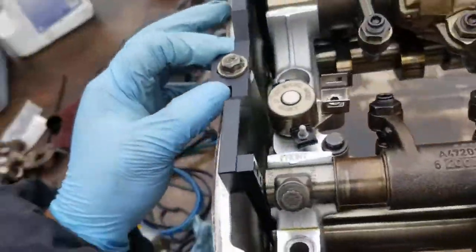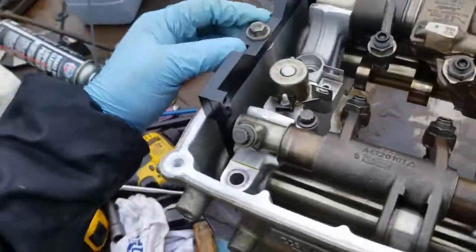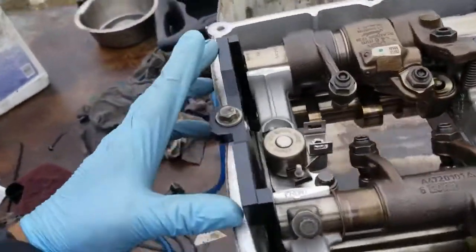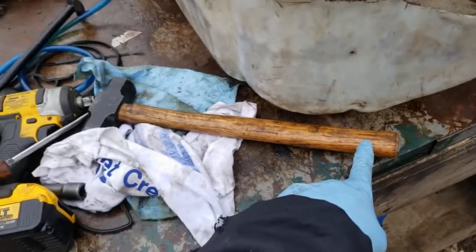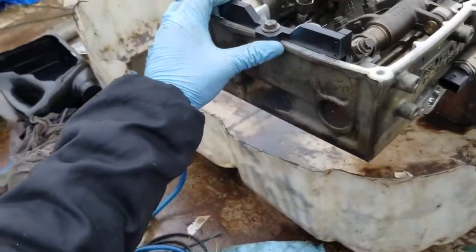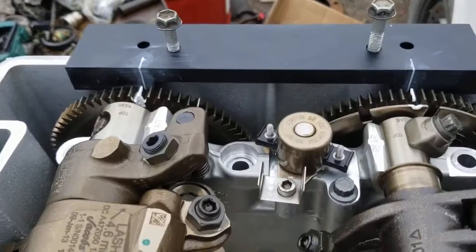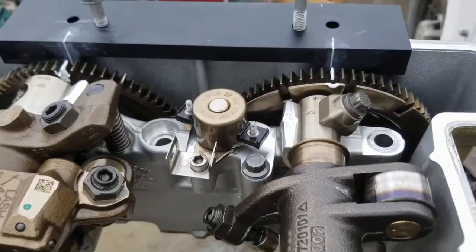This tool slides in once you have the two marks lined up. It took a bit of effort to drive this tool in — I had to use the back side of a small mallet. I tried it a few times, took it out with a screwdriver, and it came out no problem. Basically, you want to make sure both camshafts are at the right position before you try to lower the cam housing into place.